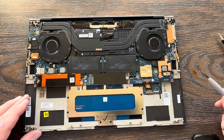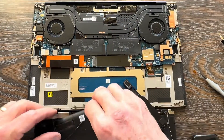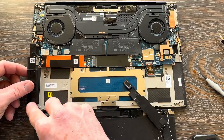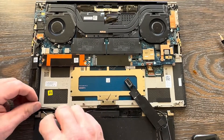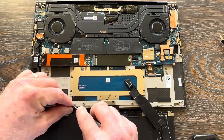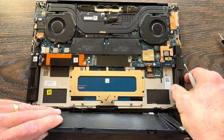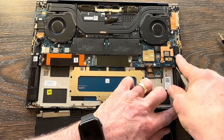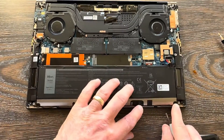Always do a quick scan to make sure you've got all connectors in. Then bring the battery and speakers back in — they'll sit right down on those rubber boot posts. Do a little bit of cable management along the bottom. Because we didn't remove the tape off the battery, once we get the right speaker in we'll just fold that battery right back up in place and finish off the cable management along the bottom.